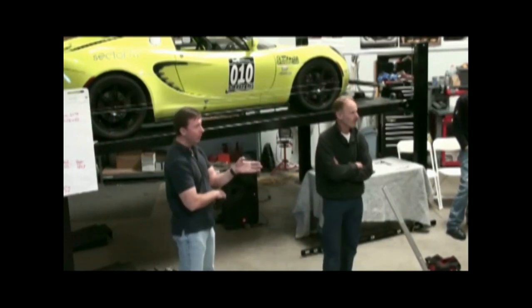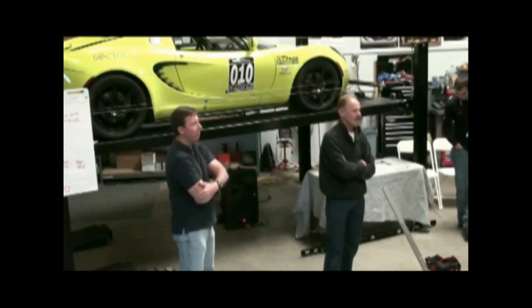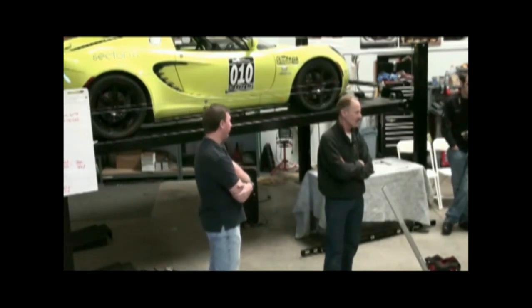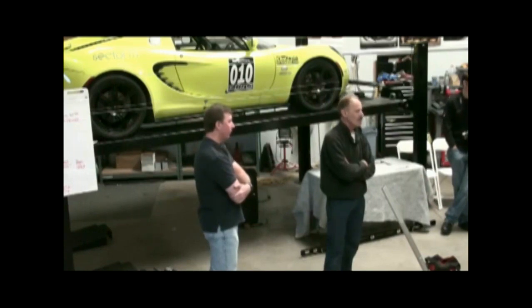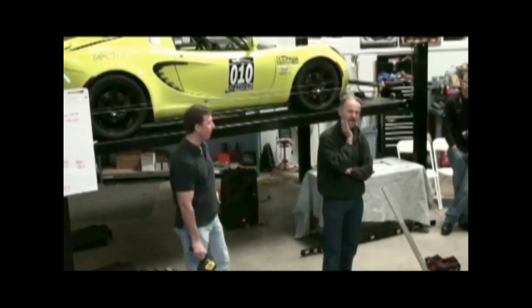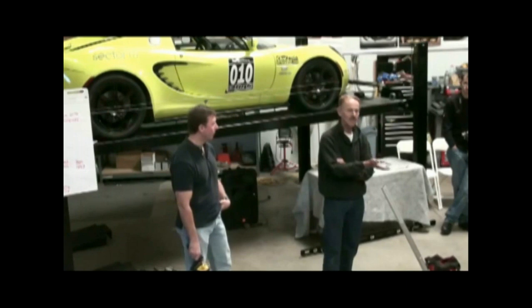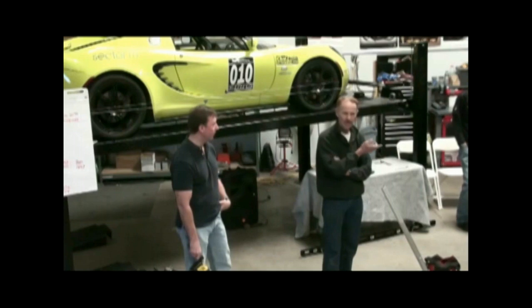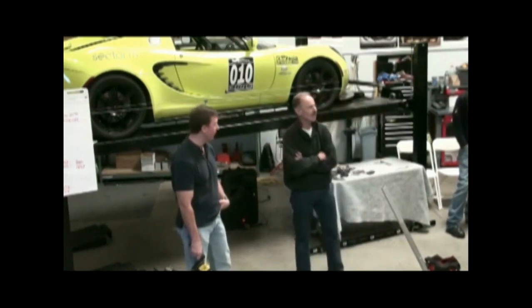Should you have it on the car for a couple weeks or a month first? Yeah — I would drive it a couple hundred miles and then let it get set. Make sure you use ride height to kind of approximate. In July he brought it up and we had maybe 150 miles on it, and we had it within a pound or two. Yesterday it was 15 to 20 pounds off — so it changed about 20 pounds over those miles.